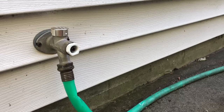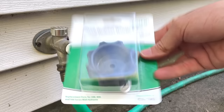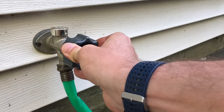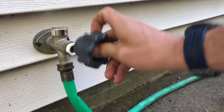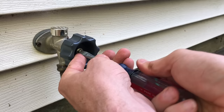When I removed the handle, I noticed it was cracked. Since these are all replacement parts anyway, I picked up a handle kit. The nice thing is it comes with a new bolt, so I can swap out the rusty one. I open the kit, put the new handle on, match up the square, insert the bolt, make sure it's lined up to avoid cross-threading, and tighten it down.